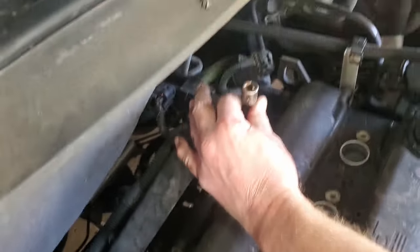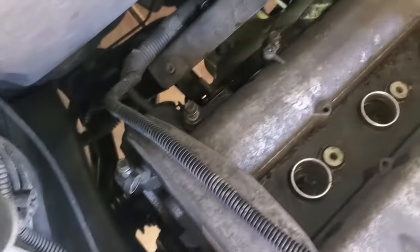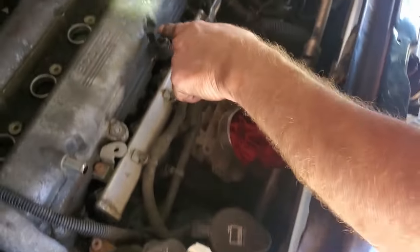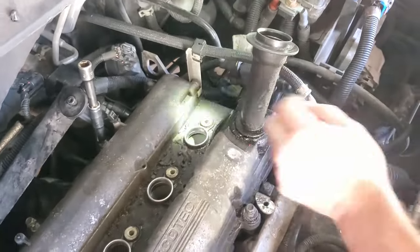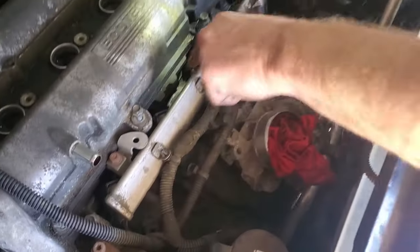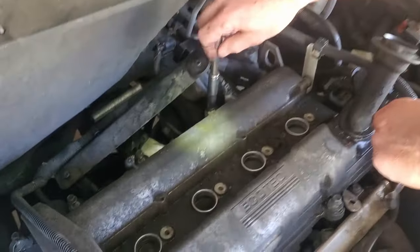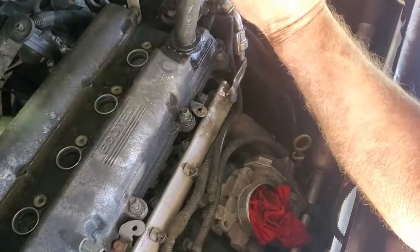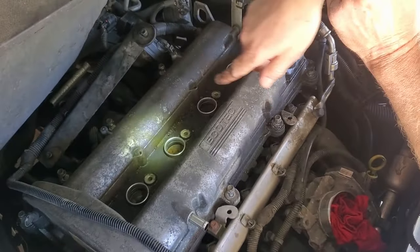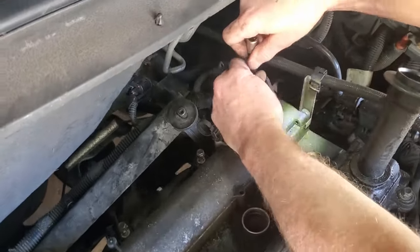We're using a 10 millimeter, 3/8-inch socket with an extender, just pulling these bolts off. I'm counting 1, 2, 3, 4, 5, 6, 7, 8, 9, 10, 11, and the 4 in the middle — that's 15. This is the fuel rail; you can see there's a Schrader valve and the fuel injectors are down here, so I'm gonna have to take this screw off to get it out of the way. Everything's 10 millimeters with the extension. The kit comes with grommets for the various screws. The front is clean; it's leaking in the back because the engine tilts that way — the oil drips onto the exhaust manifold.